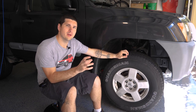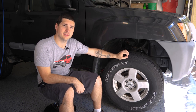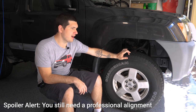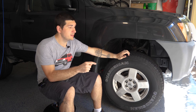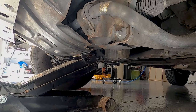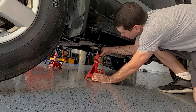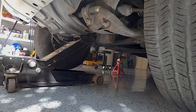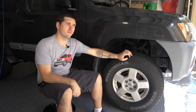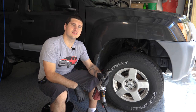If you watched my suspension lift video, you know that I talked about cam bolts. Today I want to actually demonstrate how we can swap these out. It should be a nice easy job, and I'll tell you exactly how you should have them set if you have your Xterra lifted at least a couple of inches. We start by lifting the front end of the Xterra, getting it up on jack stands, and getting the tires off. I did that by lifting in the center of the crossmember under the engine and sliding the jack stands into place. If you don't have an impact gun, make sure you break your lug nuts loose before you lift it up. Once that's up, go ahead and zip the lug nuts off to gain access to the lower control arm.